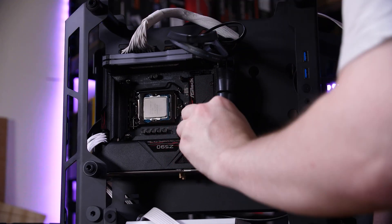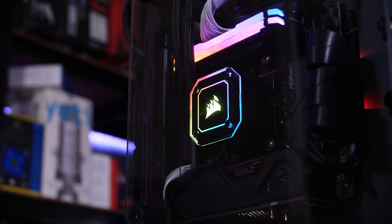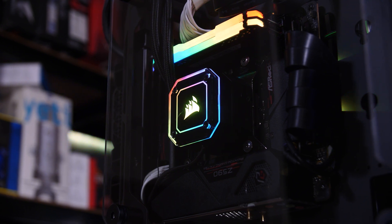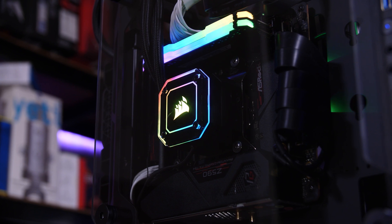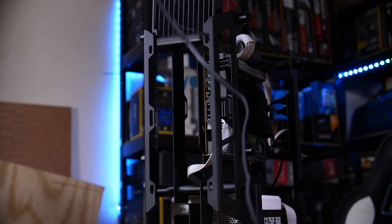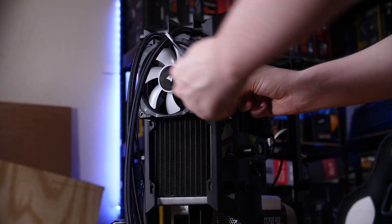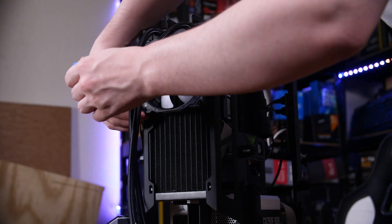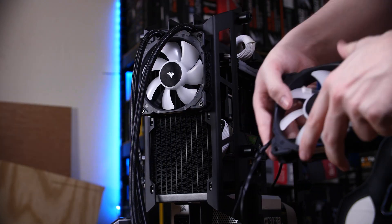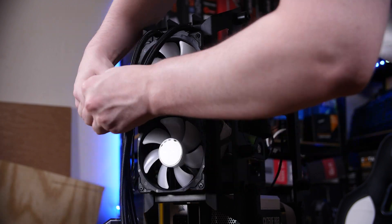Next, let's install the CPU cooler. I'm using a Corsair H100i Elite Capellix, which is a very nice RGB unit that should offer ample performance cooling our CPU. Installing it in this case is a bit of a unique situation because the case seems designed more for custom water cooling, but we can work around it. I'm going to install it on the back bracket. We're going to slide the radiator down with the tubing facing outside, and effectively sandwich the brackets with fans and radiator on either side, screwing through them all to hold it together.